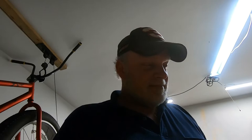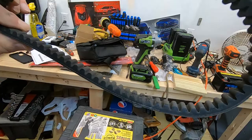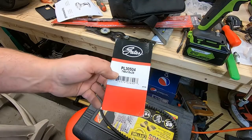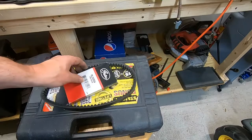I know these can be boring, but if you want to own your own scooter and work on it, this will help you if you haven't messed with it before — get the courage to get in there and do it. Most scooters are about 90% the same, there's little differences here and there. Like I say, this belt ain't totally shot — you can see them little teeth there, that happened early on. I bought a Gates belt — if you want the number and size, it's 748 by 18 by 28, that's the size for the Kymco 50 Agility 50 4T.